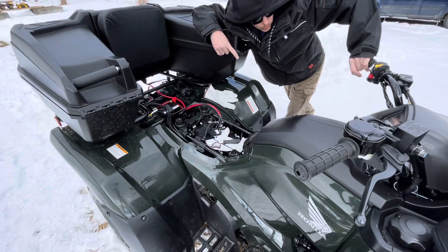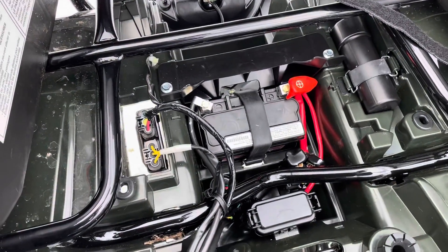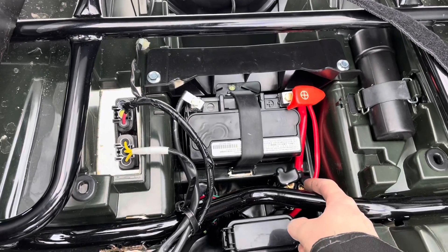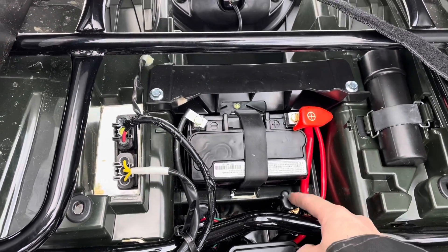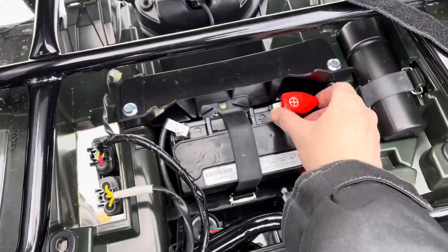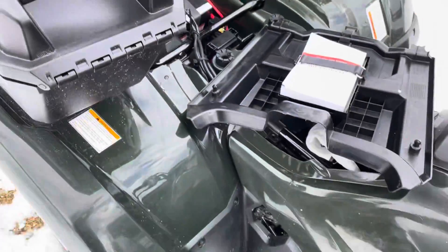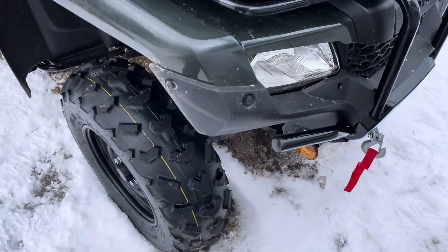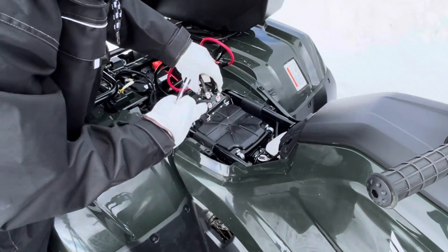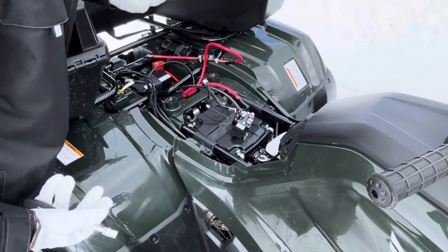We got the winch motor bolted in the front bumper — now we just need to do the wiring. I think they recommend you put the contactor in here somewhere. There's a solenoid there, and for some reason the covers are not completely over the terminals. I'm going to test out the contactor for the new winch. These are labeled — the two red and black go out to the motor and these two go to the battery — power in and power out. The controller just plugs in here, pretty straightforward.